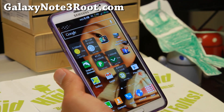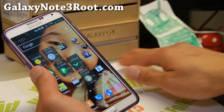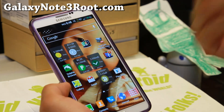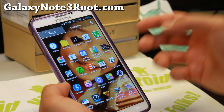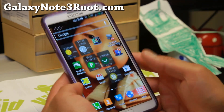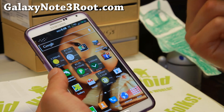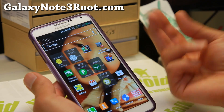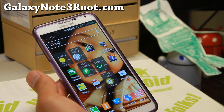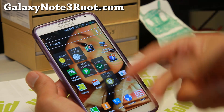Before we do this, make a backup of everything just in case, because we'll be wiping data and doing a factory reset. I did a backup using Titanium Backup. It's not going to erase your personal files and videos. Once you have those two files, you'll also need a bootloader file for KitKat downloaded to your computer. Make sure you have a Windows computer available with Odin, or you can use VMware with Mac or Linux.